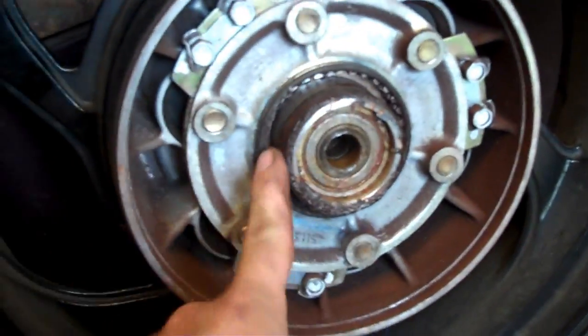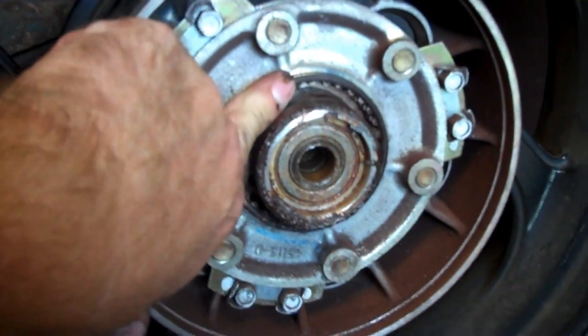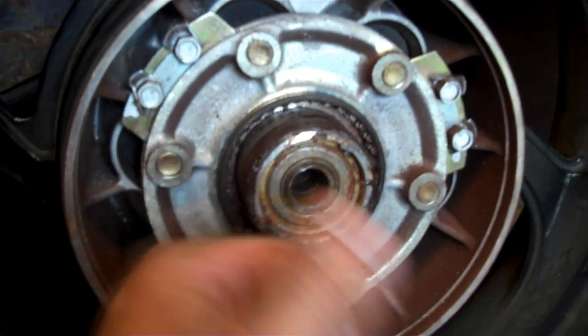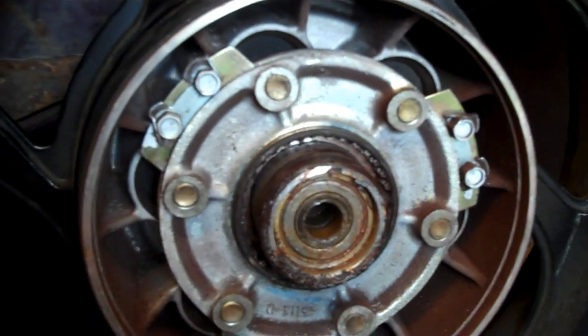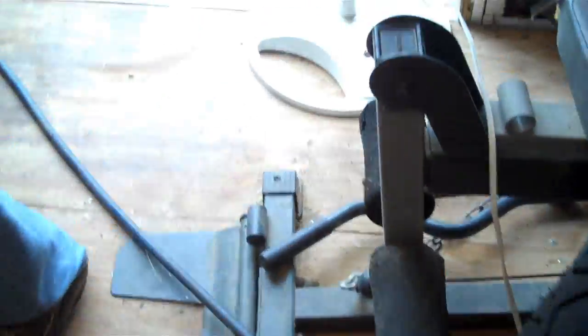Once you get the new tire mounted, here's your drive up in here. This is where the drive shaft and all that mesh is up in here that makes you go down the road. You want this right here cleaned out real good when you get it back. And you want to put some good heavyweight grease up inside here to make sure everything, no binding, everything moves like it should. Oh, don't forget that axle I pulled out a moment ago. Be sure you grease it good too.